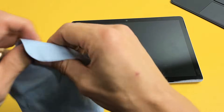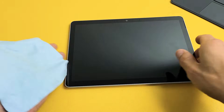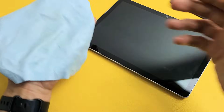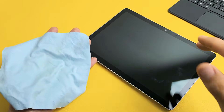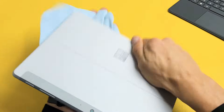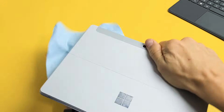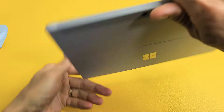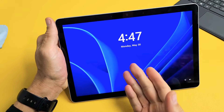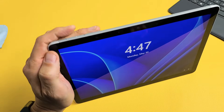If you're still not up and running, the next possible step is what I call the SMACK method. Same premise as the tapping and massage — you may have something slightly dislodged like a cable or ribbon. Hold your hand out, palm up — you can put a cloth on there if you don't want to dirty up the screen. We're going to smack the screen on the bottom and the top part, a couple of nice whacks there. Now go ahead and turn it over, tap on the power button and see if your screen is now working. If not, press and hold that power button and do not let go until you see a Windows logo appear. As soon as that Windows logo appears, let go of that power button quickly.